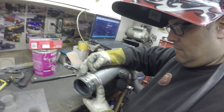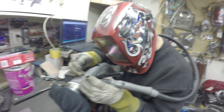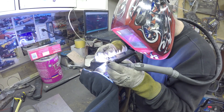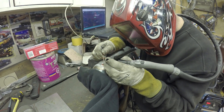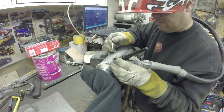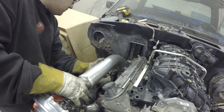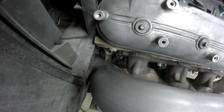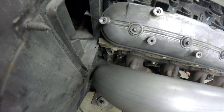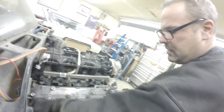We'll just grab it here and hold it. I'm only going to tack it and then double check it. I'm going to have to put a 90 on that one. Spark plug at the rear? Yeah, it's a little tight. They're straight on but I can put a 90 on there and have it going this way and it'll be fine. Look at that — nice welds. If I just change it to a 90 degree boot for this one, I can still get it off.